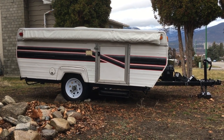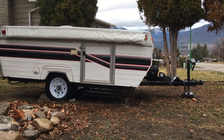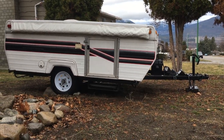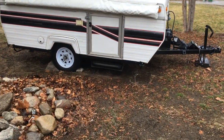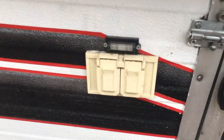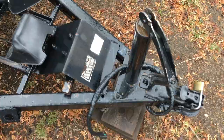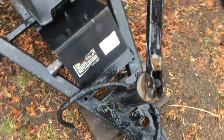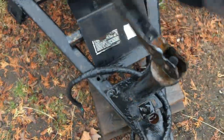As you can see, the front of the pop-up camper is lower than the rear. I do this partly because when it's parked there, the water will drip off of it. I need to raise the front of it. We go to the side of the pop-up camper where you'll see the bubble level. To level a pop-up camper front to back, we use the tongue jack. I need to raise or elevate the front of the camper, so I turn the tongue jack clockwise to raise it.